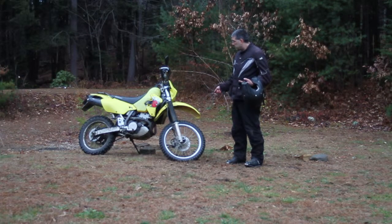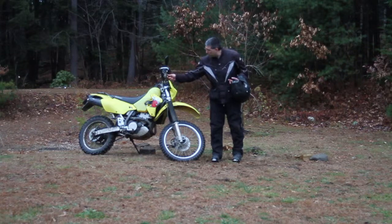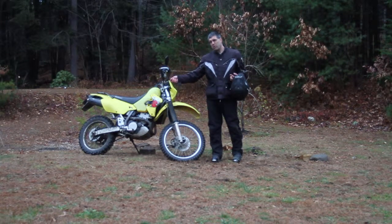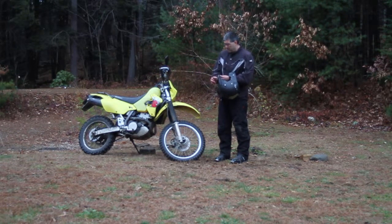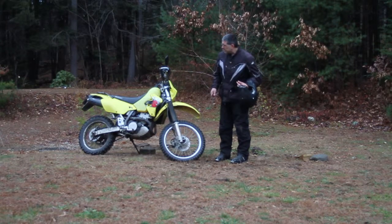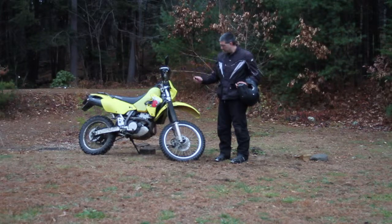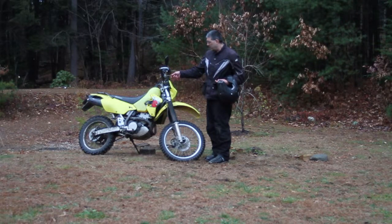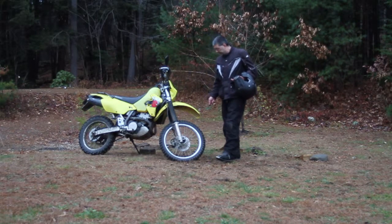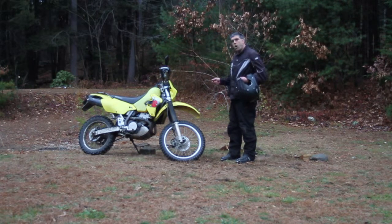So, what we're starting with first, oh, and by the way, the rear tire, 15 pounds on it. Manual calls for 18 on the front. Manual calls for 22 for driver alone, 25 loaded up with a passenger. With a really stiff carcass tire on there in the woods, that's just too much air. It's just too sharp, too slippery. So that's 15.5 pounds in the back, 15 in the front. Back tire is a Kenda Trackmaster 2 760. Front tire is an IRC TR8. Sorry about that.